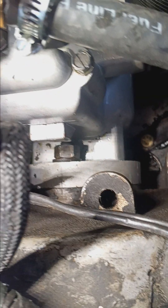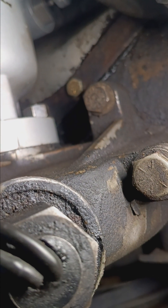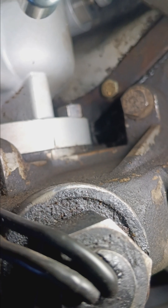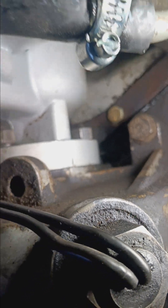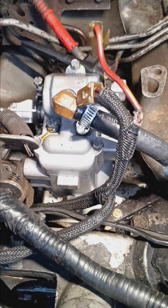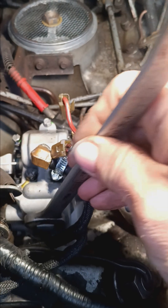There's a line at the top, right there in the center, right in front of that nut. That's the line I use to line the pump up. I notice there's a second set of lines over here to the side, and if I were to line those up, that would be a pretty good advance on the timing. So I'm going to line those up. A three-quarter inch wrench will fit right on that boss that you can see right there, so I found a longer wrench to give me a little more leverage.